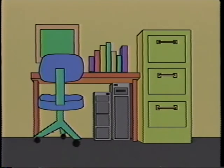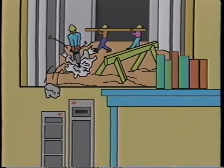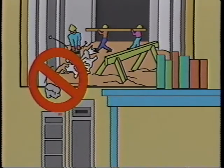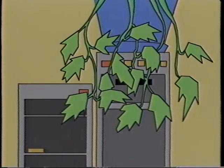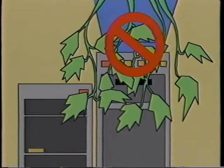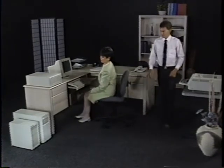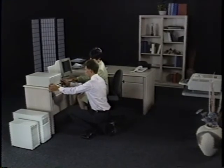There are several things to avoid when setting up the HP 3000. The computer shouldn't be under a desk or table, as this restricts the airflow for cooling. You also don't want it next to an open window — although this is good for ventilation, it's bad for dust and moisture. And obviously, you don't want other objects on top of the HP 3000, as they represent definite dangers to the system. In general, you don't want too much heat, cold, vibration, dust, or moisture. The HP 3000 is a complex piece of electronic equipment and it should be treated carefully.